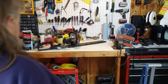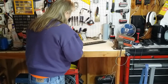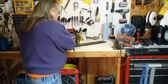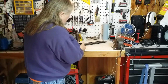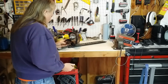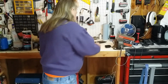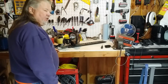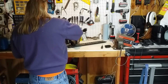Put you up in a stand. Let's pull the cover off the air cleaner. You always want to make sure the foam hasn't deteriorated and you start sucking old foam fragments into the carburetor, and I don't know if that's what happened, but there's no foam in this. Air cleaner element is missing. Well, there never was one or something. This works around dusty environments. You'd think you'd want one in there. Alright, let's see what the fuel tastes like.